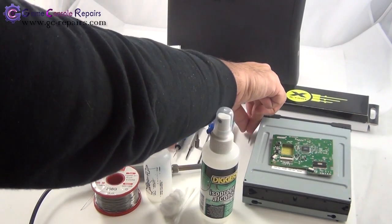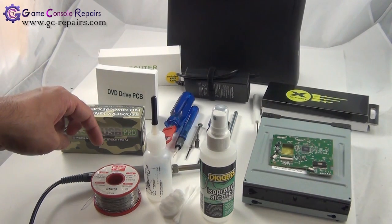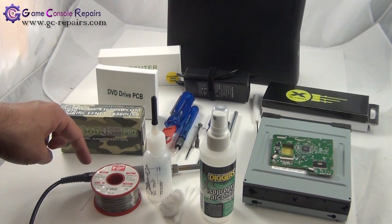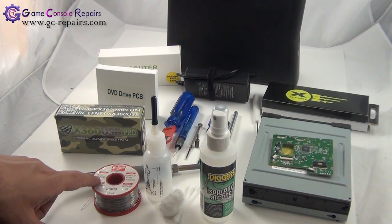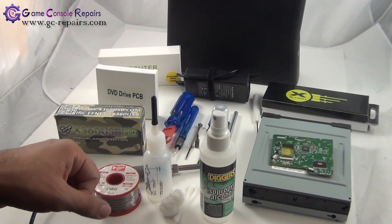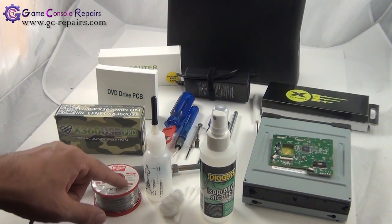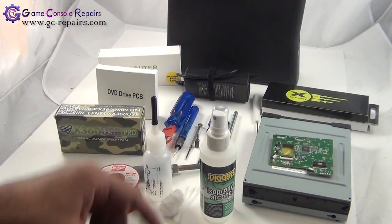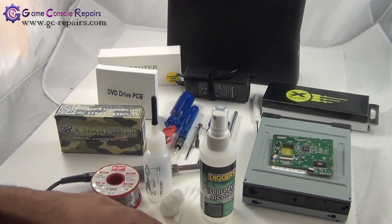You'll also be needing a bit of soldering stuff. A 30 to 40 watt soldering iron, preferably a reasonable soldering station is always handy. Solder, the ratio we have here is 60/40 and the diameter we use is 0.46 millimeter. Flux aids and helps in the process of soldering, and we'll be needing some cleaning stuff. We'll be using isopropyl alcohol, some cotton balls and Q-tips.